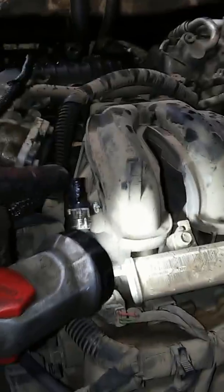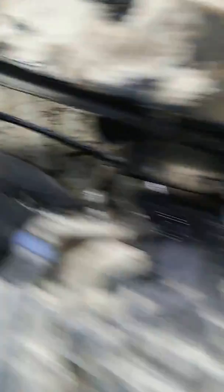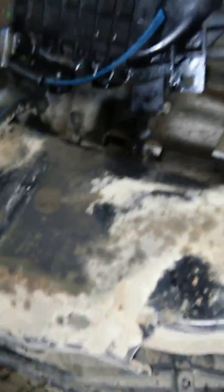Here's the fuel line — you disconnect it right there. You disconnect the wire here on the alternator; it connects here at the starter and comes over to the alternator bolt. You have to pull that cable out otherwise you'll break it. You don't have to fix the major wire. The starter switch wire is all contained in this area, so you don't have to worry about that one — just the one big black wire that goes to the starter and the alternator. Other than that, it's easy peasy — just drop it down with everything.